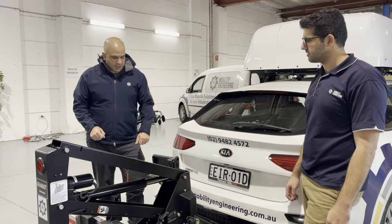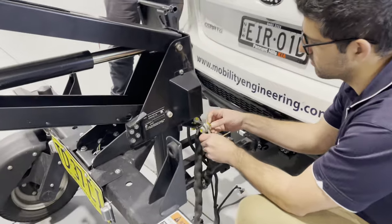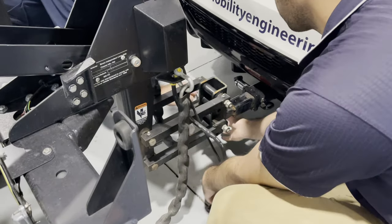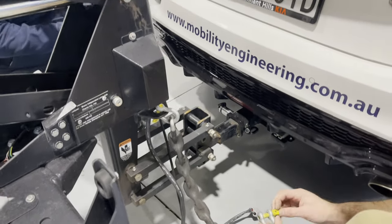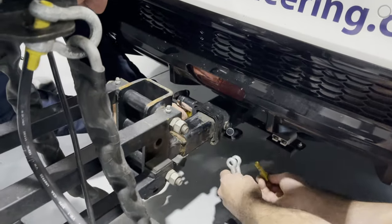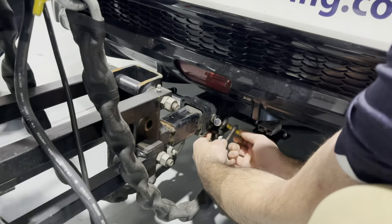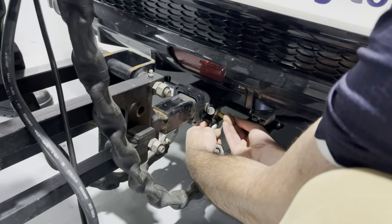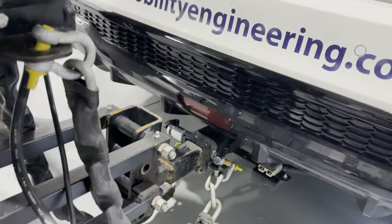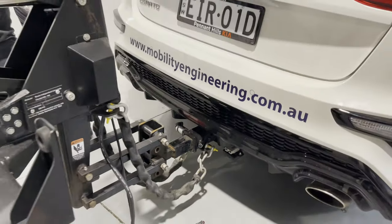We're all secure — hitch in, safety pin in, wheel bolts removed. The next step is to reconnect the safety chains. We undo the safety chain from its support position and connect it to the safety chain attachment points on the tow bar of the vehicle. Safety chains generally have a D-shackle on the end. Newer generation Chariots have D-shackles and chains, which are more secure than the carabiners on older versions. Hand-tightening the shackles is sufficient — they're very secure when hand tight.